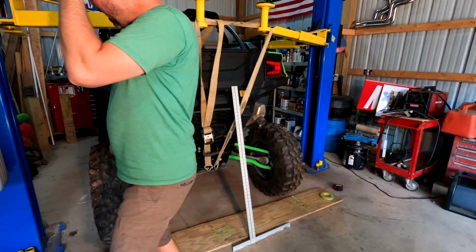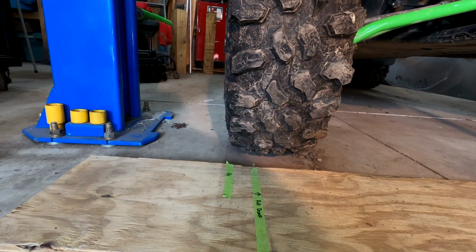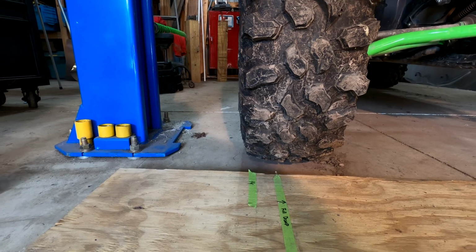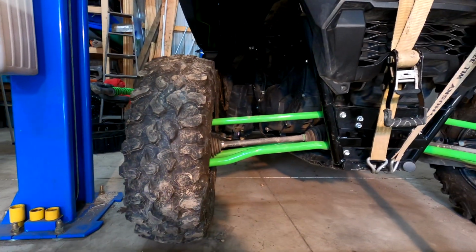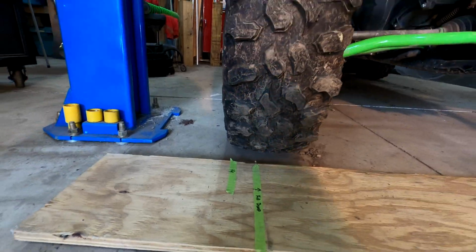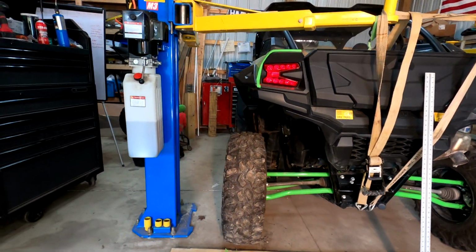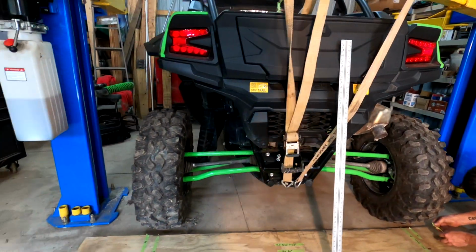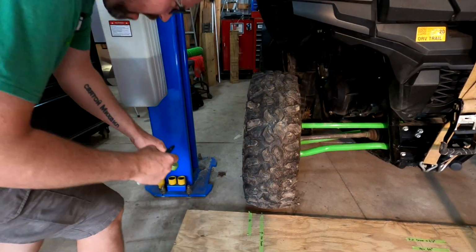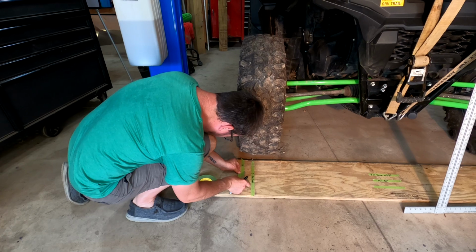So let's come on down to what I would say is just past half droop and see what happens. Right to where I would say the trailing arms are flat. Just a touch more, just a smidge, right about there. So that's going to be our widest total distance. And we're still almost level. We did gain, but we didn't move so much on this one.